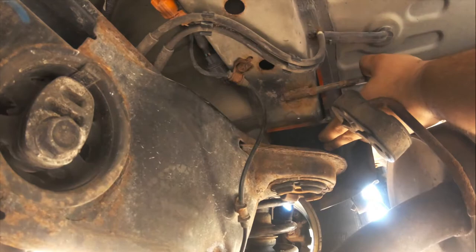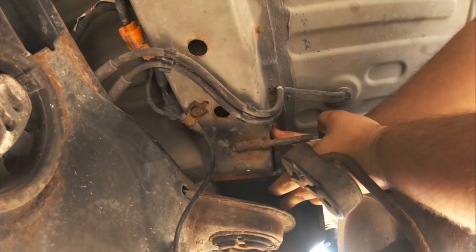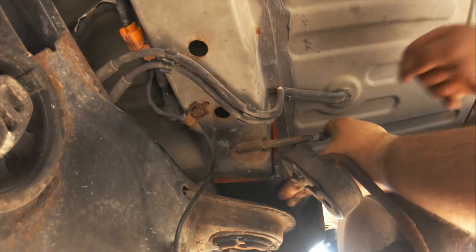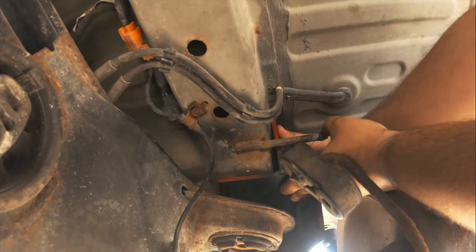It's not flush yet because I have to remove some metal on the right side, but it's going to go up something like that. When I jack this up I'll mark where to make the hole, then weld it in — make the hole first, then weld it in, and then from the top I'll make a bracket and connect it all up.